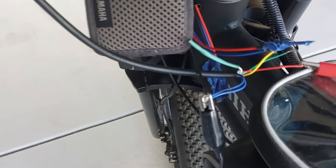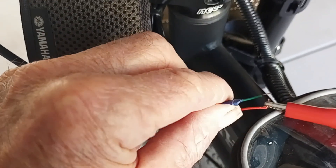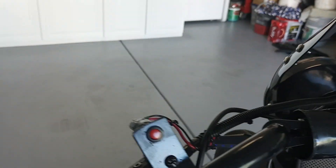So I take the red wire off my light and my blue wire — which controls that back blue light — and I wired them together with the yellow. The yellow is the left turn signal and the green is the right turn signal. So when I hit my switch, I get turn signals.